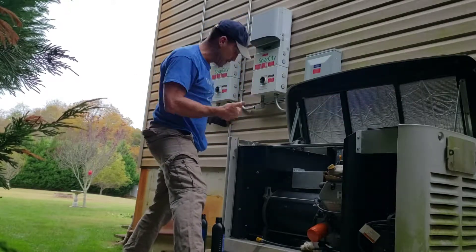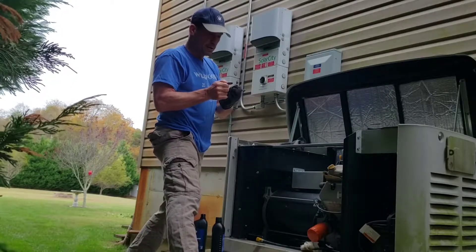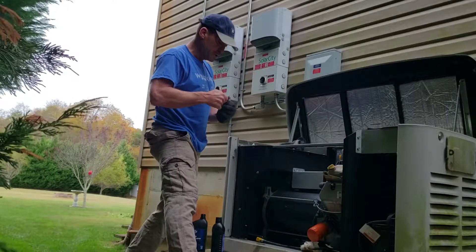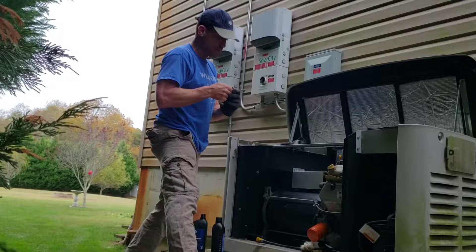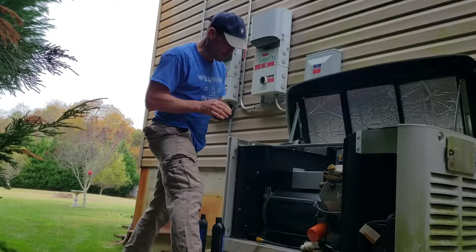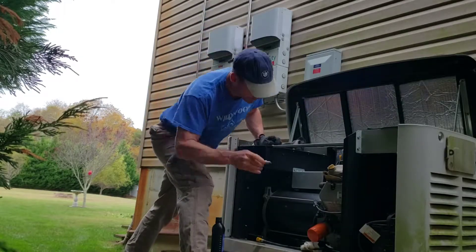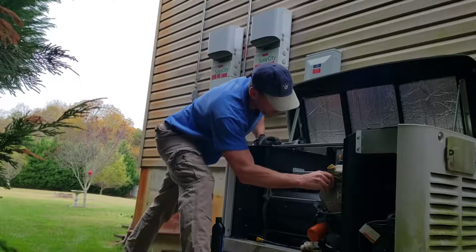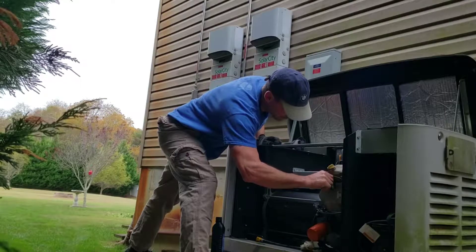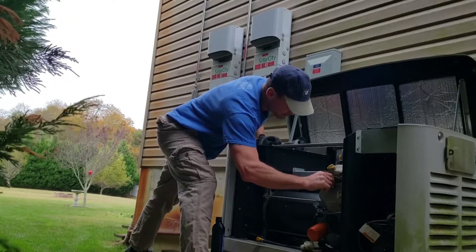This spark plug looks just about as good as new. If I was installing a new spark plug, I would gap it — for this specific generator that's called to be 0.03 inches. It's right there. You can press it down on concrete or pry it a little bit either way. Be really careful putting your spark plugs in. I stripped a plug once on my boat motor and had to helicoil it — it's a pain. That's not something you want to have to do.